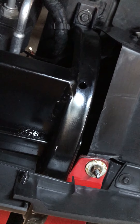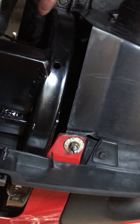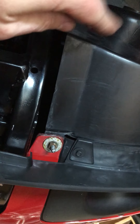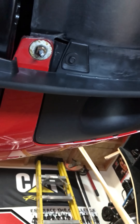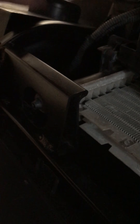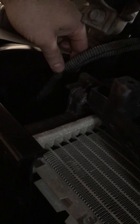There's a little insert that goes into the frame of the car — if you strip it out, it's gonna be a pain. There's a horn wiring harness that plugs in on this side. Other than that, the wiring harness goes through — one plugs into the marker light, one plugs into the fog light on the front, and the other plugs into the headlight. On the other side, basically you have the same thing minus the horn harness. It pulls right through the bracket. There's a push-pin style connector that holds it inside the harness.